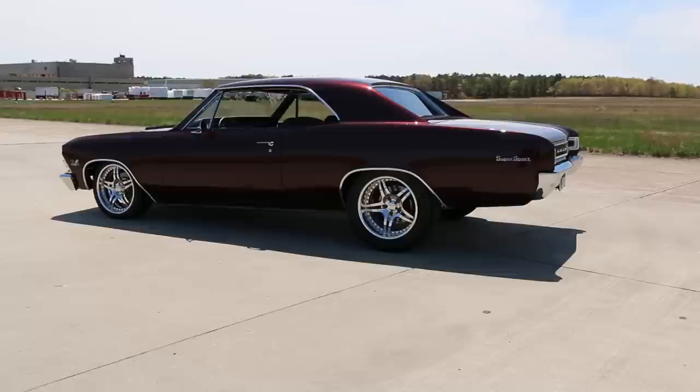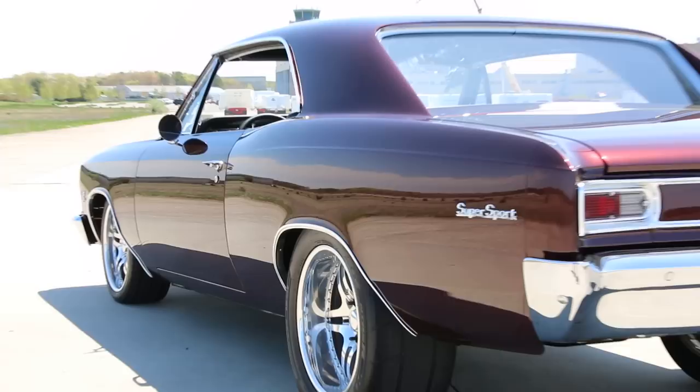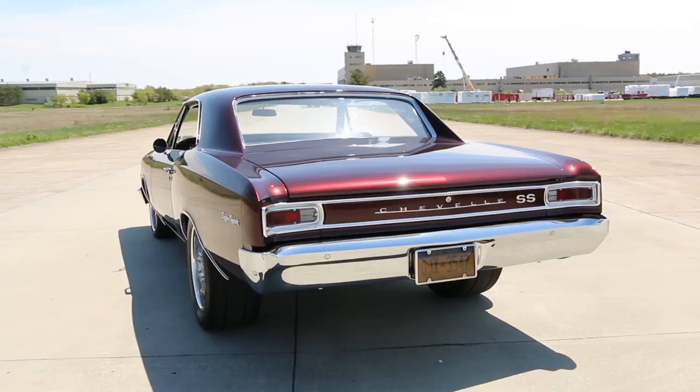Motor is a 427 small block. Dart Sportsman block, bored over 40. Eagle crankshaft, Scat rods, Ross Racing pistons, block is decked to zero, AFR heads, TD shaft mounted rockers, and a custom ground Ultradyne cam, 685 lift.